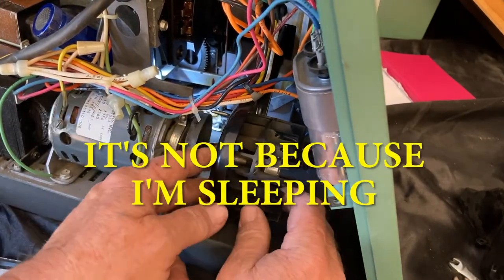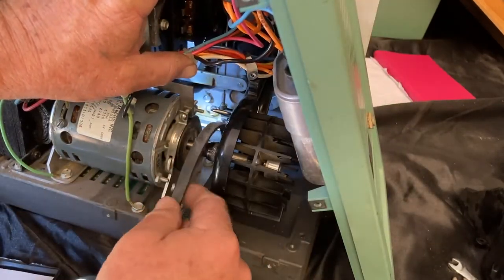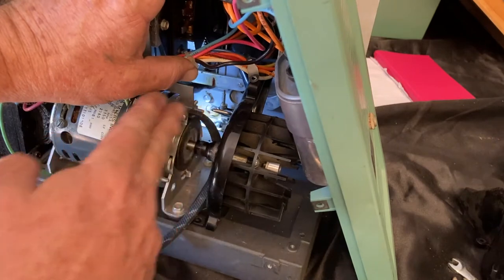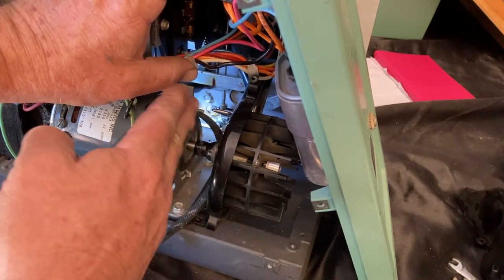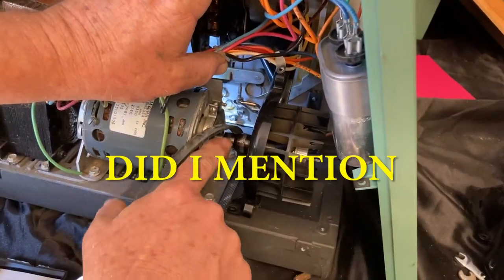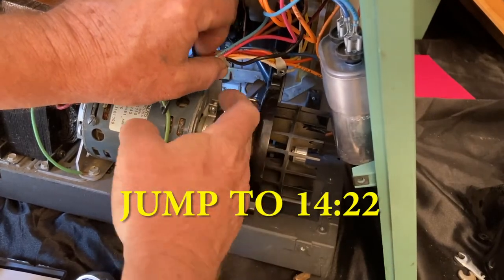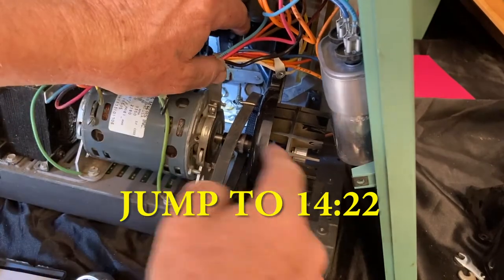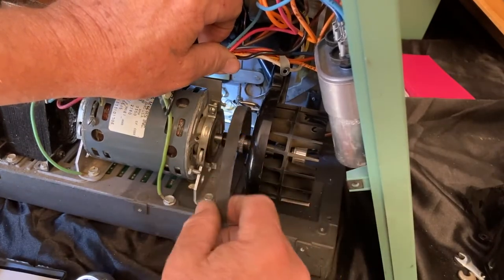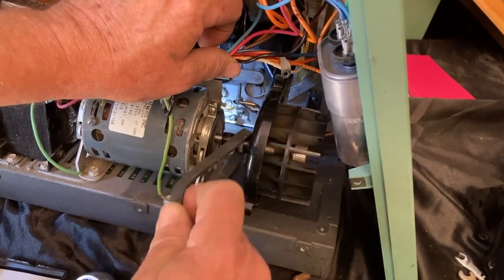Okay, so now I have to connect everything back together, and then it has to go up and through. There's a wire here. See, that's a guide that's for like 24 frames per second and then 18 frames per second. So this is something that moves this over onto this thicker drive shaft and the thinner one. So anyways, it's gonna have to go up through there and then up to the pulley up here, but I'm not going to show you. I'm just going to reassemble everything and have it like it was before. Only now the belt is on this pulley shaft.